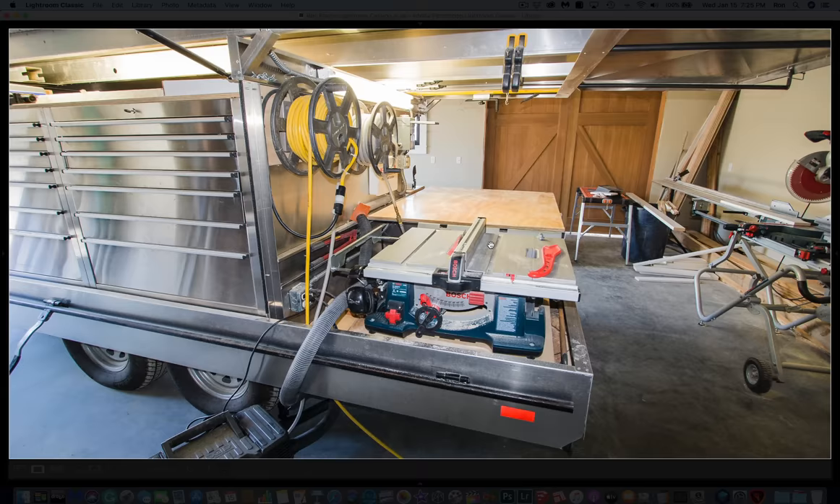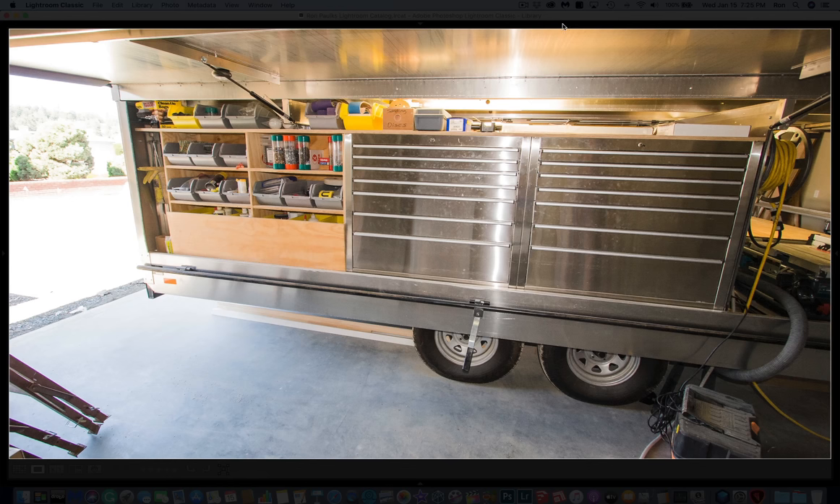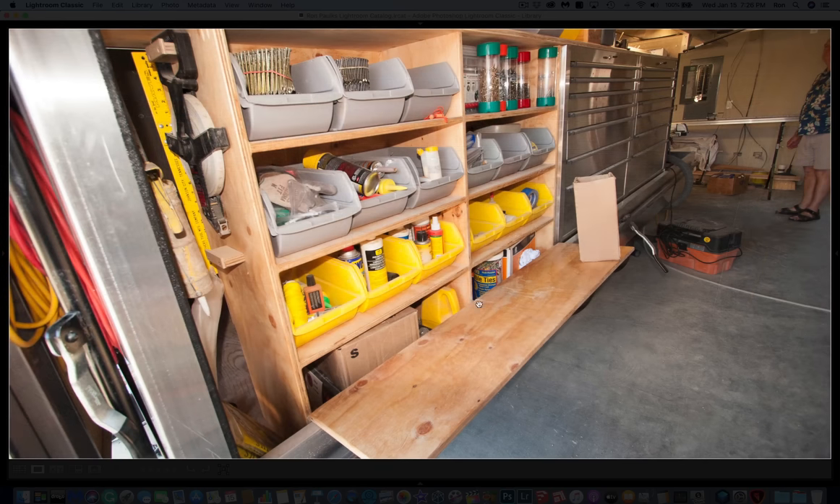This is the other side — another door, just like the other side, flips open, not as deep. I put a couple of toolboxes in here. Again, I build my own now instead of buying these — you get more exactly what you want with the drawer sizes you want. We built this one in, and then this little panel here I put on with a hinge. It flipped down and gave us a little more work area. We could pull stuff out and set it on there — this is pretty much screws, nails, backstock, and things. It was just on a piano hinge. Once you flip this up, you let it flop down and it would rest across the frame of the trailer — that kept it nice and sturdy, so we could set heavy stuff on it.